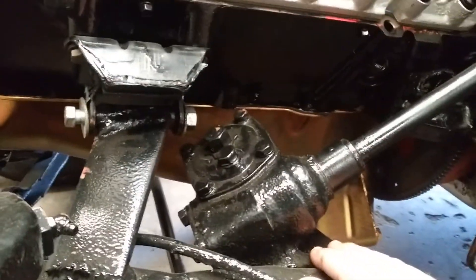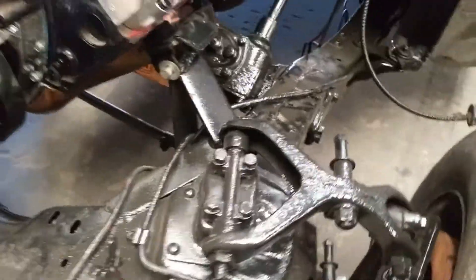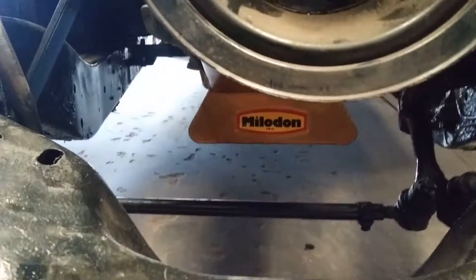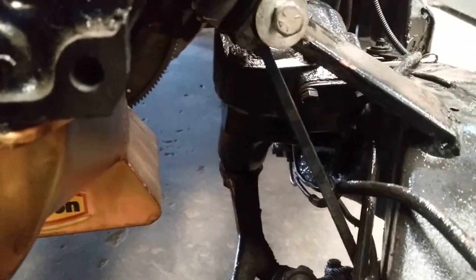What I'm gonna do is cut this steering out of here, get rid of the steering box completely, take it apart, and from here down I'm gonna make all new — replace these rods and everything underneath with new tie rod ends. The motor should be down about four inches, so I'm gonna cut these brackets off and lower the motor down where it should go.